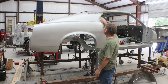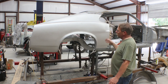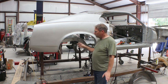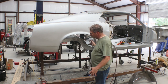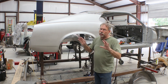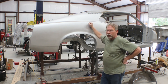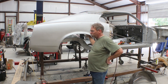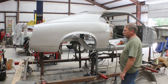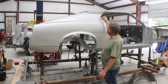What I'm thinking I need to do is come in here, cut the panel right about here, cut along about half an inch from that edge so that flange is free, set the quarter panel, then come back and weld this piece back on and fill the three-sixteenths to quarter-inch gap. I think that's going to be the only way to get the quarter panel in the proper place. Good news is the inner fender is in the correct place — there's a little room to pull it forward or back — and generally it's within about an eighth of an inch of where it needs to be.